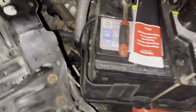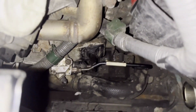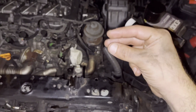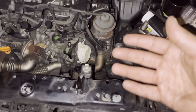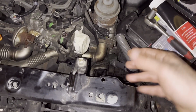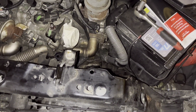And I also inspected the fork. When I removed the cylinder, I put my finger in and felt around the fork. This ball on the right side, on the inside, where it sits, I inspected the back side to see if it was worn, because when it's squeaking, it means hard friction between metals, like in this case. So yeah, it was okay, so I knew that I'm good to go.